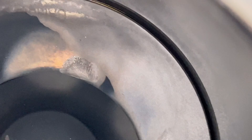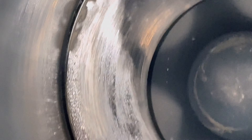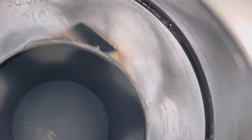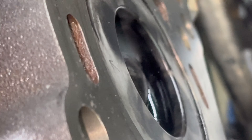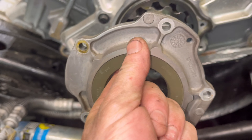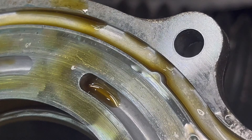Cylinder four. Cylinder one. Passenger side — let's look over here. It's probably 5,000 miles after we got done building the engine. Might have a little dirt but doesn't look like any witness marks on the passenger side. We just got number six as a suspect. Look at number seven — we have protrusion. Look at number six — we do not. The front crank seal was not leaking. This is the old pump cover, the one that was existing on the truck. They got some lines — definitely could be a lot worse.